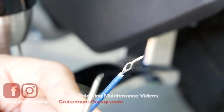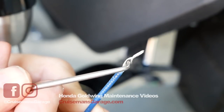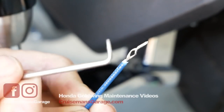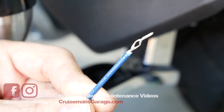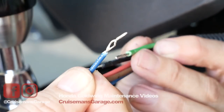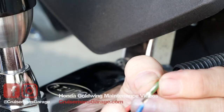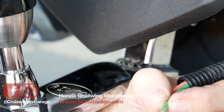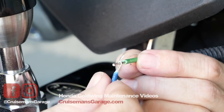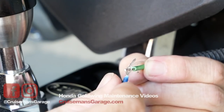What I did here is I've twisted my wire and poked a hole right in the center of the wires using a little angled pick. Then I take my wire from the isolator and slip it through that little hole, then twist all this together. It just kind of slips in there like that — twist it together and solder it really well.